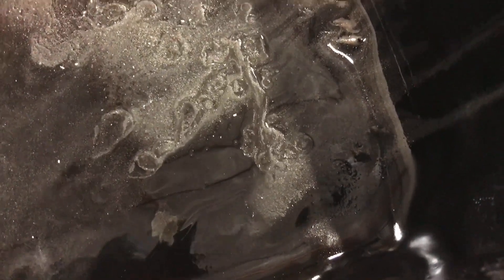Okay guys, this is not what we wanted to see when we pulled the pan. Check out all the debris. There's a lot of stuff going on here. This is not what we wanted to see and it doesn't bode well for the bearings or the crankshaft.